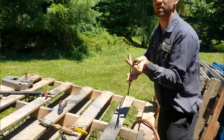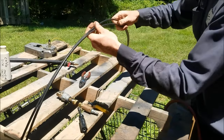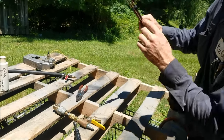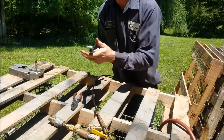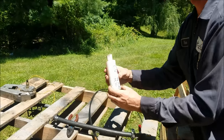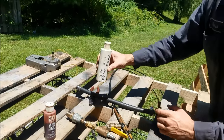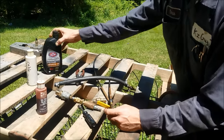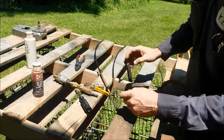Do you have to remove the cables from the boat? No, but I like to because it makes it a little bit easier. These cables right now are real tight. First, make sure you don't have any frays or cracks. If they're super tight and frayed on the inside, you're going to have to replace the cables. But if they're not, here's what I use: my cable lubricant, which is basically a mix of Ultra Slick assembly lube and SAE 30 motor oil. You want thick oil in there — light oil doesn't tend to last as long. If the cables are really tight, you might want to use automatic transmission fluid or rust penetrant first to clean all that crud out.